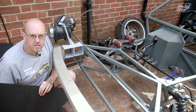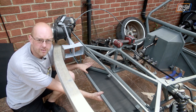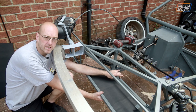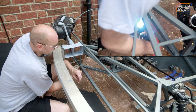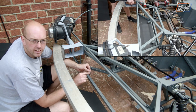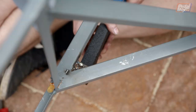Everything is dry. This is the first part we're going to attach on the car - it goes underneath the radiator support at the front. I don't want to attach this all the way onto the main chassis, just onto the front section so it can bolt on and off as one. I'm going to place a mount in this corner and a mount in this corner, right next to the bracket but not actually welded onto the main chassis, and probably two more across the front. The first two mounts are made out of some 30mm bar with a 5mm hole drilled in - we're just going to use M5 bolts. We can put a rivnut in really easily, so that'll need a 7mm hole but we need the 5mm hole in first to drill this in the right location.